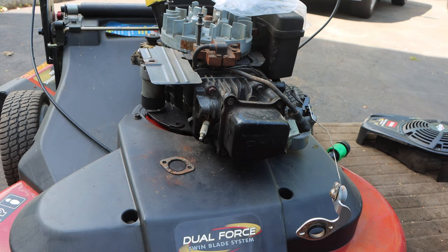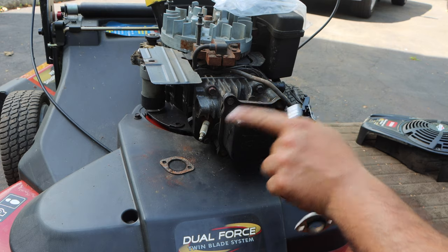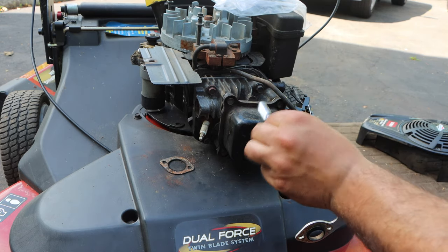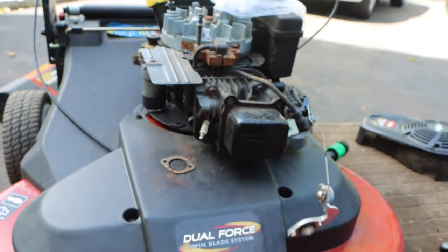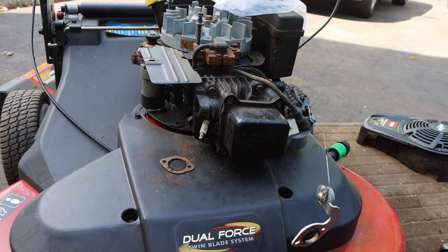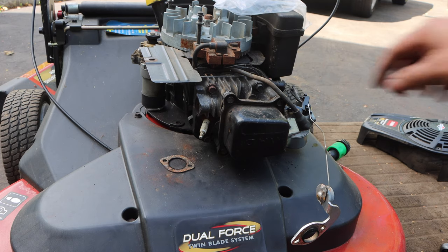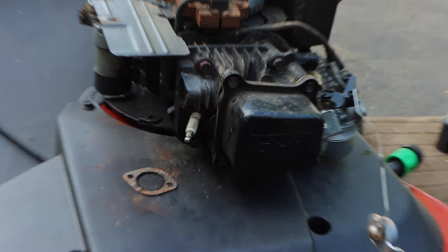I wonder, we're thinking out loud, if we can get away without touching the valve cover. We could just pull the head out, like so. And it seems like that is the case. I think these are 10 millimeter, and that's a bad thing. All right, so it's a series of four 10 millimeter bolts. We're gonna pull it with the valve cover still on.